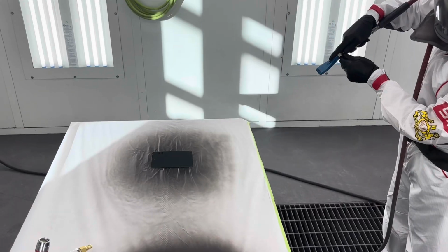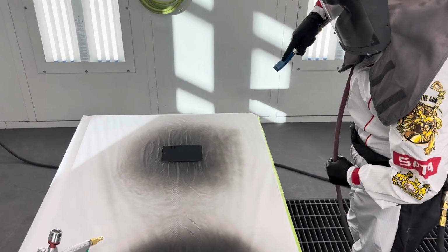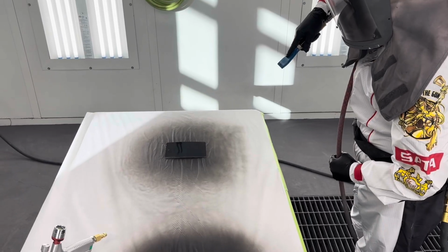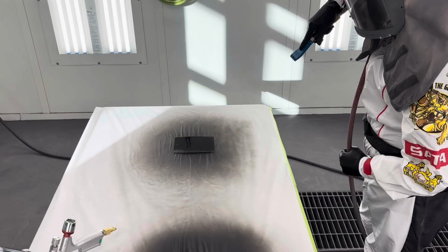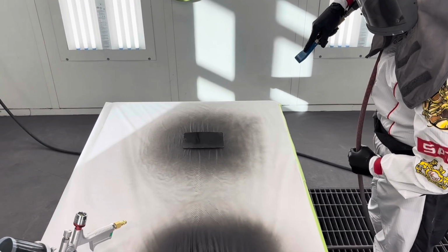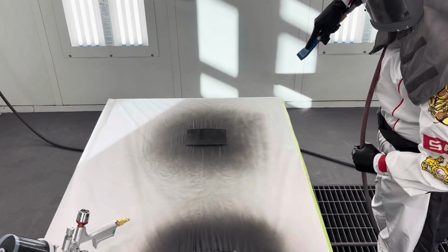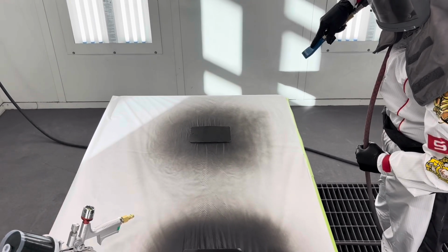This video has been sped up to twice its normal speed, and it depicts properly applied base coat that is using a proper procedure for the dehydration with this venturi tool. When it was timed with a stopwatch, it took exactly 52 seconds for this base coat to reach the point of appearing completely matte and dehydrated.